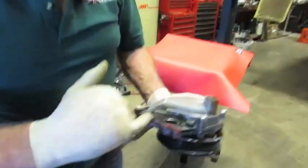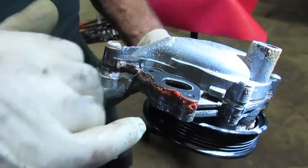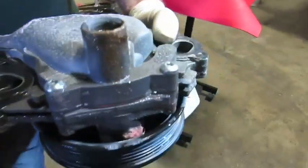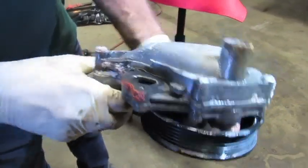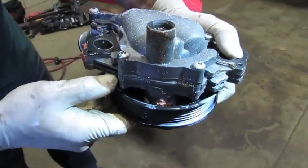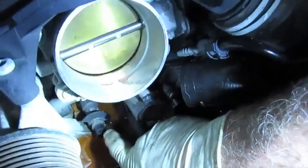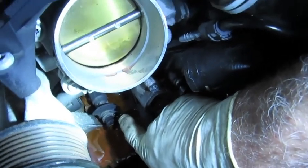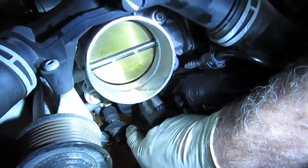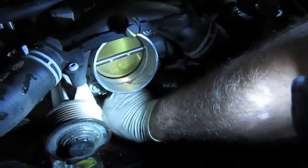If you look carefully, you can see evidence of the gasket leaking around the water pump — there's hard or gelled coolant present. Also at the bottom of the water pump, likely out of the seep hole. The next step after removal is to remove and replace the small plastic black bypass hose that goes from the water pump to the supercharger coolers on the intake manifold, done by giving it a quarter turn.